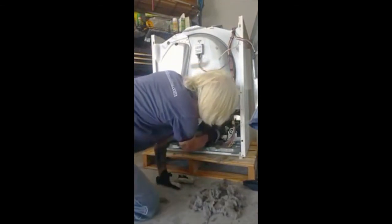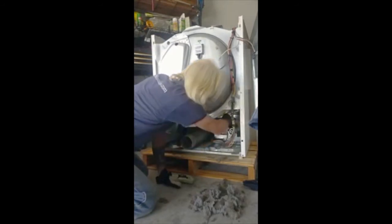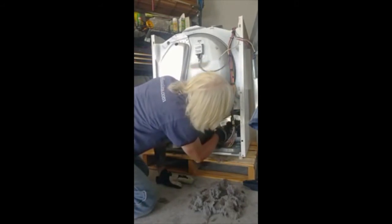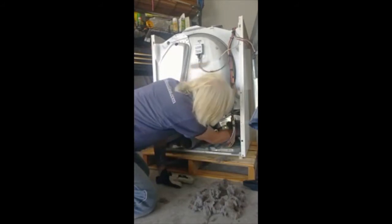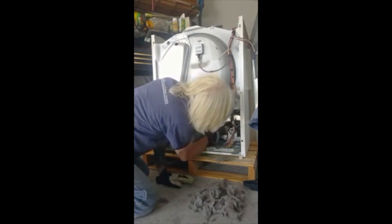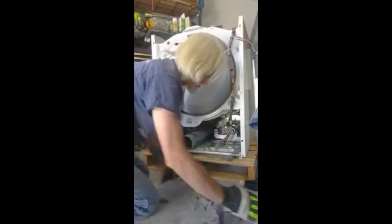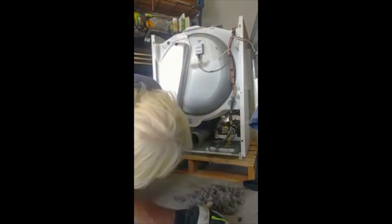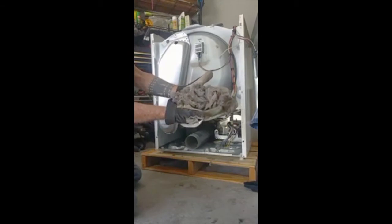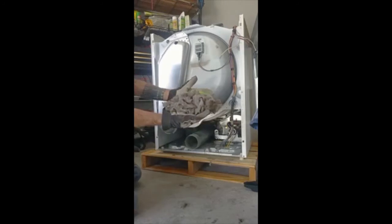Get in here and clean all this dust out from the motor — it ends up everywhere. Spin that free to make sure you get it all out of there. You see there's a lot of dust that gets in around that motor, around the slack adjuster and all. You need to get all that out of there.